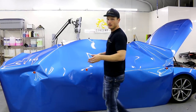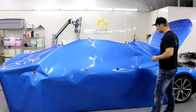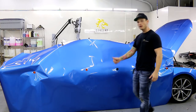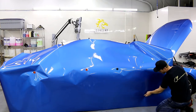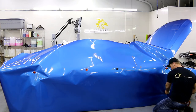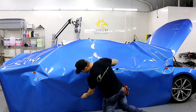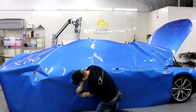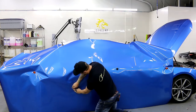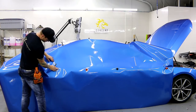What we're going to do first is cut out the doors. The door frames are chrome trim and gloss black, not painted framed, so we can actually cut this vinyl a little bit higher and then drop the doors down. I want to make sure I cut a bit higher up on the bottom to have coverage on that side skirt piece. This cut is actually going to go into the door area, but I'd rather not have enough for a door than lose 12 to 14 feet of film needed for the entire quarter panel.